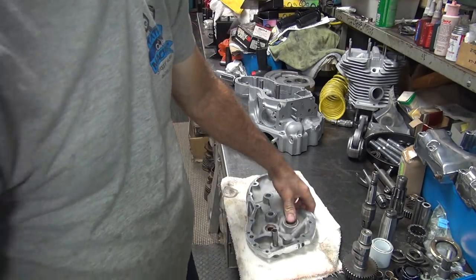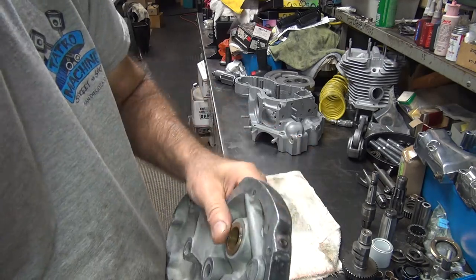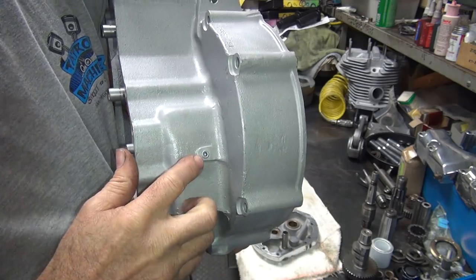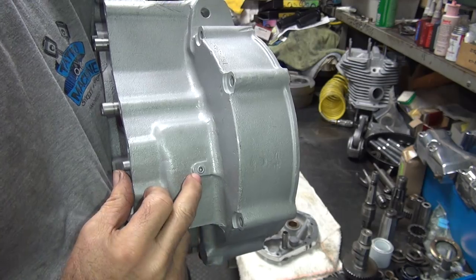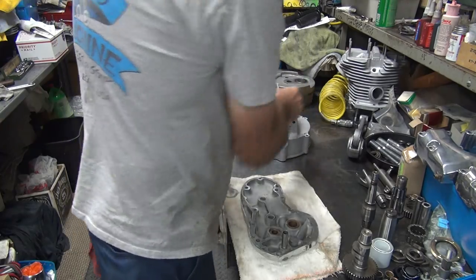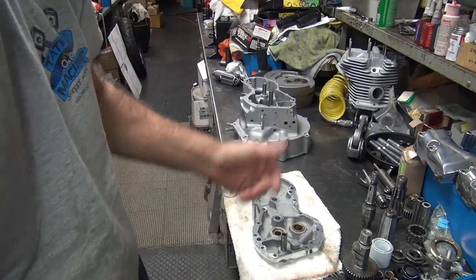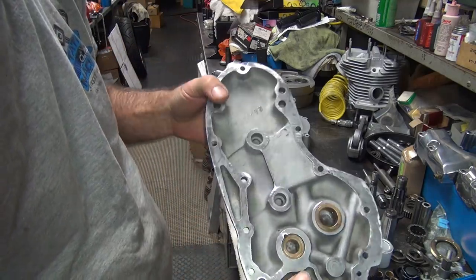The customer already wants to put new stuff in here anyway. Looks like somebody put a set screw in here. There's one on the bottom of the case over here that I haven't pulled out yet. I'm just going to pull it out and check that oil gallery. There's a plug right in here — the plug's always been cut out and they put a set screw in it. That's the only way you can really clean that gallery up good. I blow on them and when I quit feeling grit it's pretty clean. I usually leave it at that.